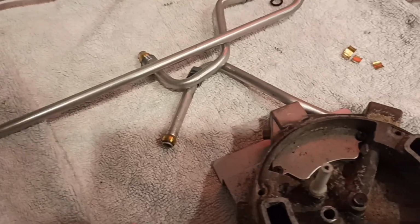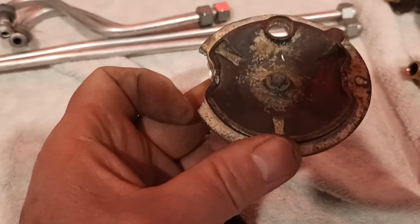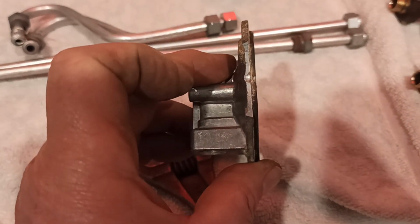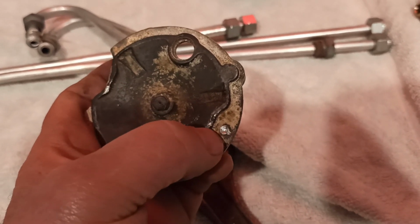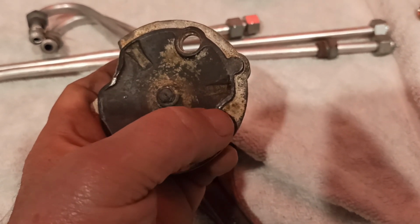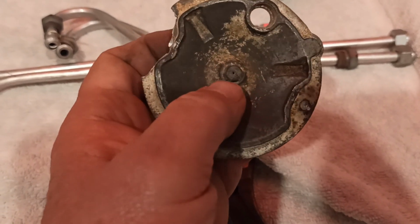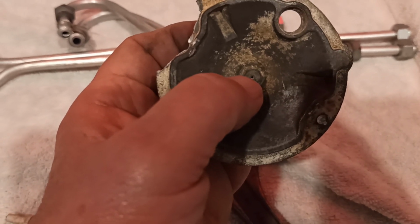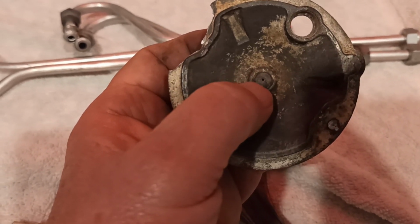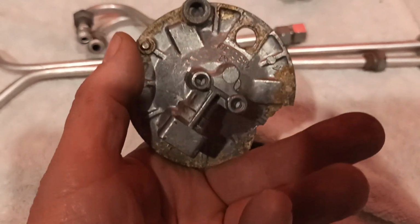So what's next? What have we got next? Oh, and while I was doing that, because I had to hold on to these burners with the multi-grips, that bit of the burner broke off because the aluminium was a little bit corroded, and there's another screw there, so I'll probably try and break that off downstairs rather than drill the screw out, and then that'll give me alloy here. I've still got to take the brass nozzle out of there. That's what regulates the amount of gas that comes out. That just screws out, and then that'll be done.